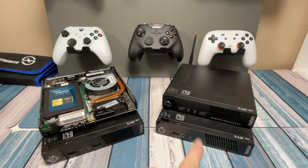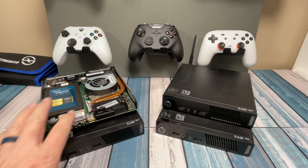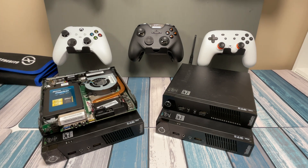What I've got in front of me here is a couple different i5s and a couple different i7s, and I've got one of these open just to show you how easy it is to open it up and work around it. There's a hard drive right on top here that's easy to swap out, and then two screws underneath that gives you access to your RAM — you can pop out the RAM sticks and throw in new ones.